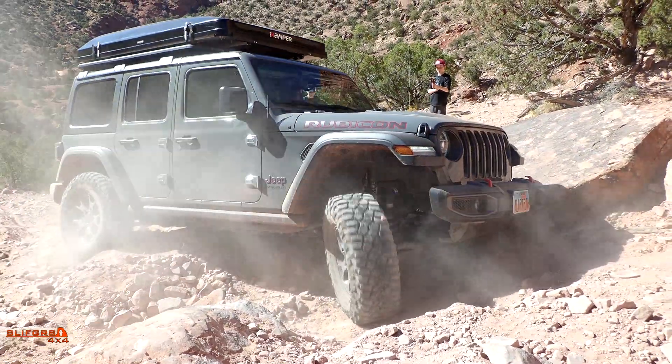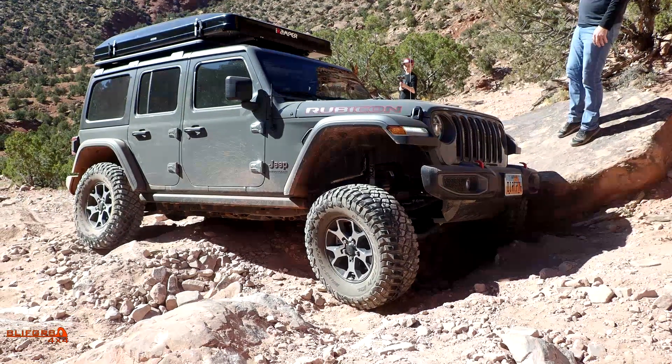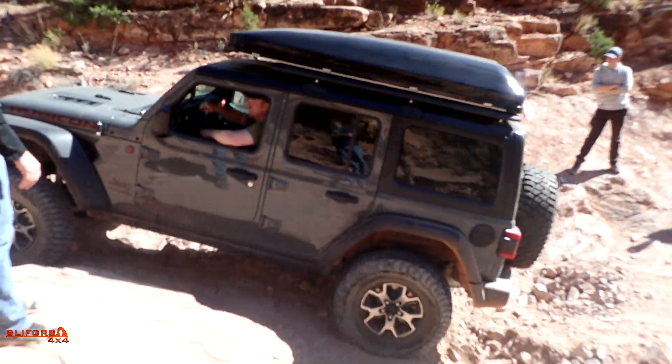This shows why many manufacturers — like Toyota on the Tacoma and 4Runner — equip vehicles with just a rear locker and not a front locker. Honestly, you would need three wheels in the air to be immobile in that configuration, and if you've got three wheels in the air, that's just a bad day anywhere. That said, on extreme loose terrain like Rose Garden Hill, where we went this past year, even having front and rear lockers was tested. On extreme technical trails with loose and variable terrain, you want maximum force from all four wheels, and for that you need both front and rear lockers engaged.